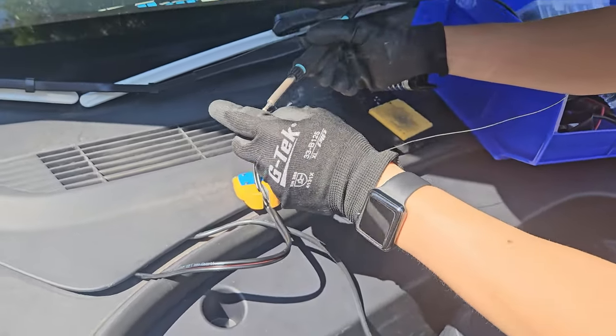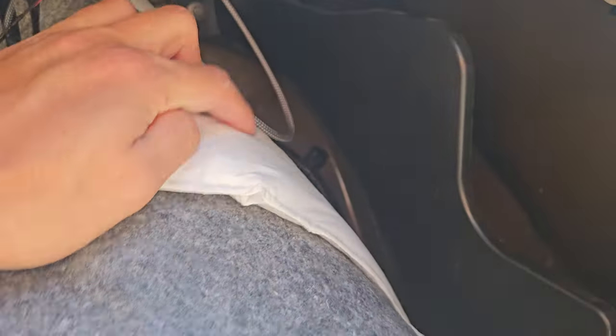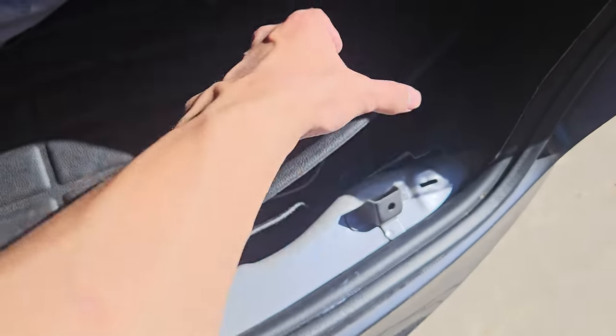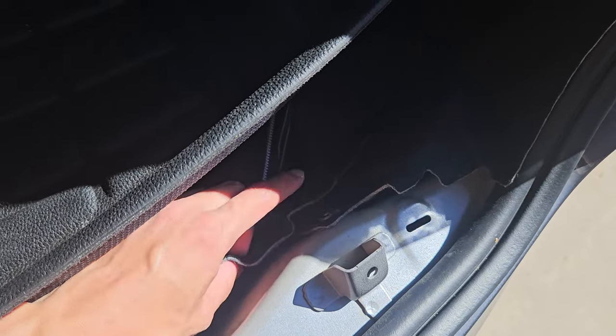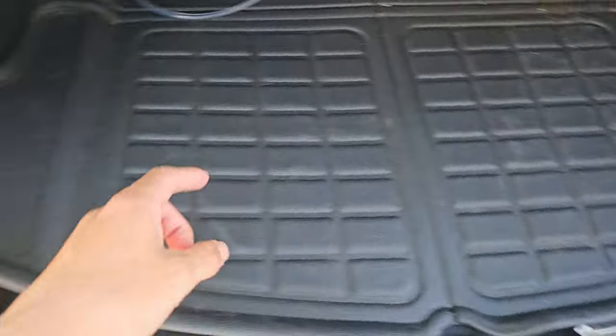We're going to cut the underglow wire and solder it to the wire that we ran through the entire cabin, so it runs straight into the battery in the back. Now for the dangling wires — instead of passing them through the slits, we're going to run them along the back of this carpeting. I took this panel off — it's just held in by clips. Be careful with the weather stripping when pulling it up. Then pass the wires down here and out from underneath. Just a clip here and a clip up there to hide the wires.